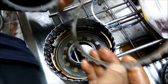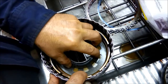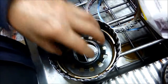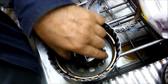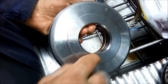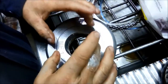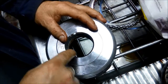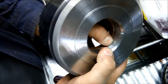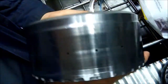You've got your cushion spring there, and we just checked that that diaphragm spring isn't broken. We'll probably replace this. There are two reasons why that can burn: either the seal on the piston is leaking, or the rings that are applying pressure are leaking. So you want to make sure that where the rings sit in there is okay — it hasn't worn a groove or anything in there.